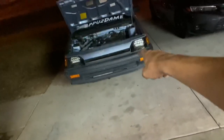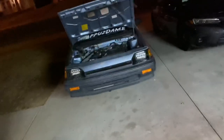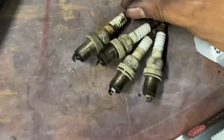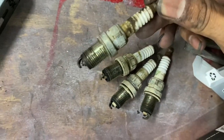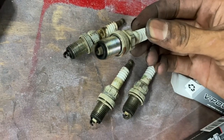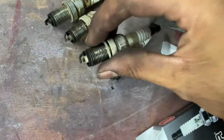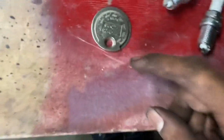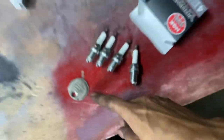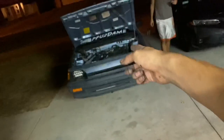The Yoke has been misfiring - the B16 has been running kind of funny again. This is what the spark plugs look like - she was running very, very rich. I'm not too sure why, but we have a fresh set of spark plugs. I gapped these to 0.039 of an inch. Let's throw these in and see what's up.